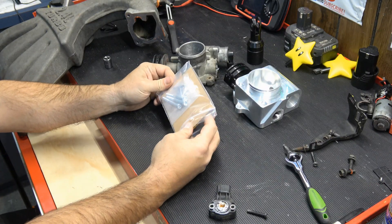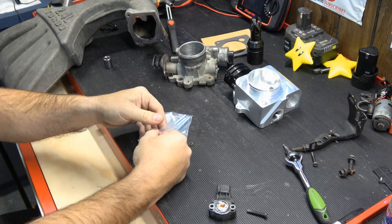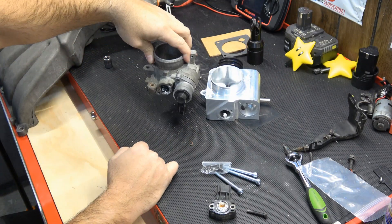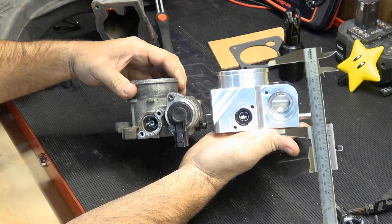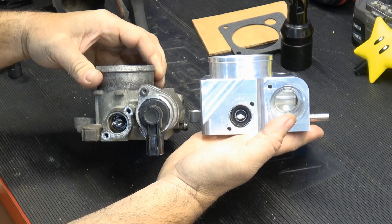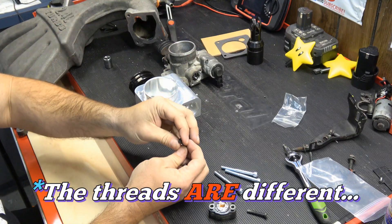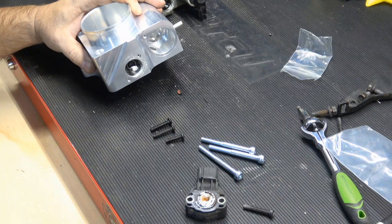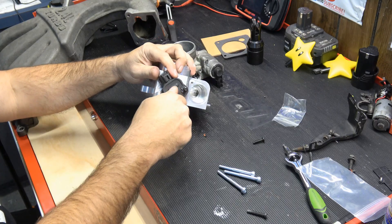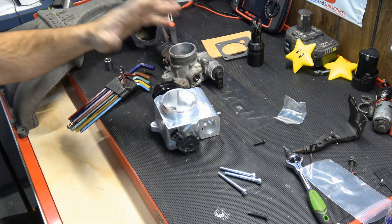Here's the hardware kit that Modern gives you — got that new gasket. These three longer guys are going to be the mounting bolts. They are now Allens, no longer 10 mils. It's a really good thing they give you this if you consider how much larger that piece is. As far as the engine's concerned, it's not going to know a difference between the intake manifold and the charge air pipe. Look at how much thicker that billet aluminum piece is — it's insane. It also comes with sensor bolts, which is very much appreciated. We have two that are longish and one that is shorter, so I'm assuming the shorter one goes to this hole. Thread these in — it went from a Torx to an Allen, looks like a three millimeter key. TPS installed.